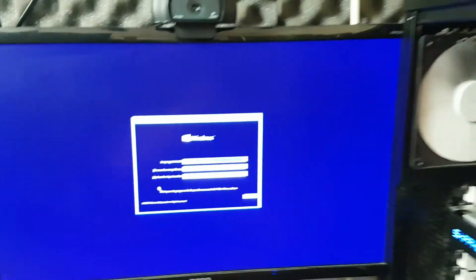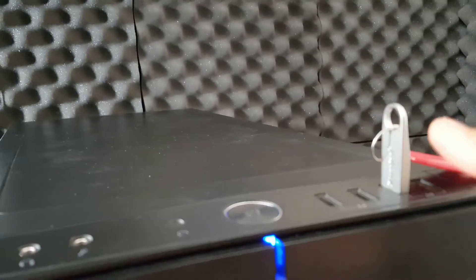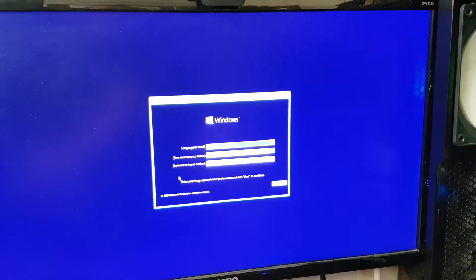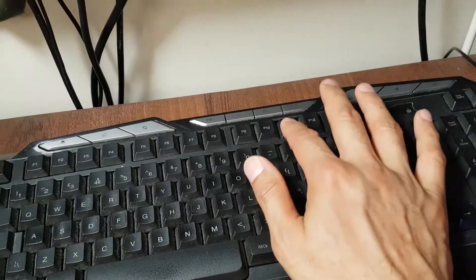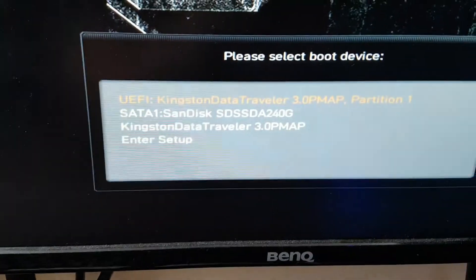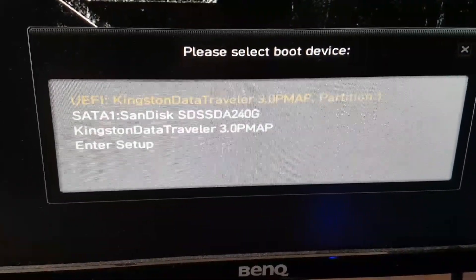However, if you don't see this window, and you know your USB drive should be working because you've tested it when you created the installation disk, then it could be that your boot order is not set up properly. You're going to have to restart and select the correct boot order. On this motherboard we press F11 to go to the boot order — this is the MSI B450 Tomahawk. By pressing F11 I've accessed the boot order menu and I can see UEFI Kingston Data Traveller, which is my USB installation drive.